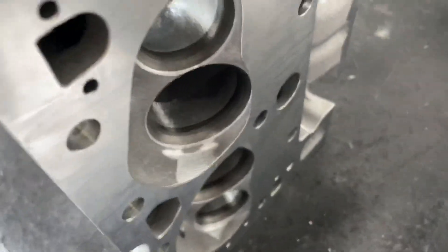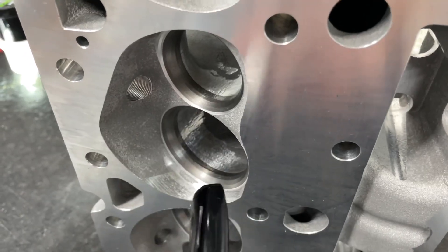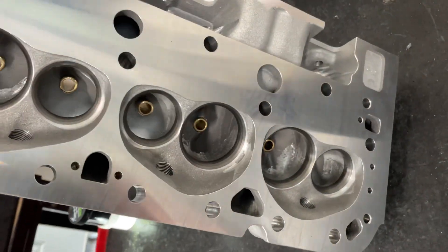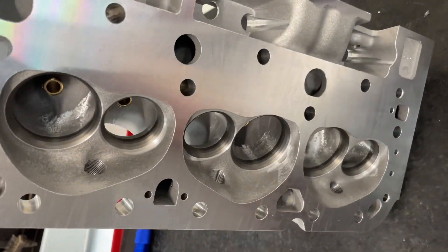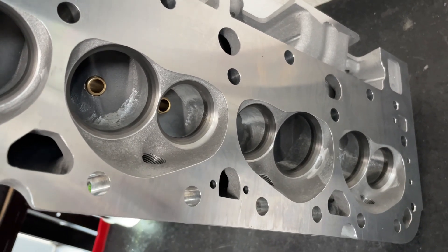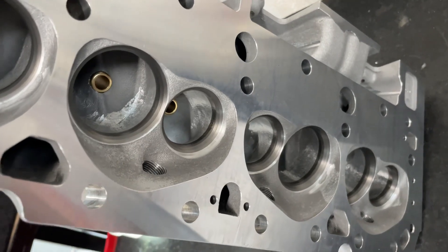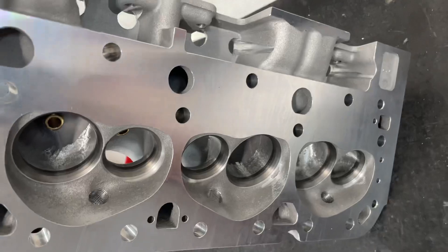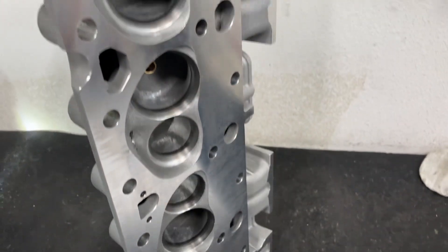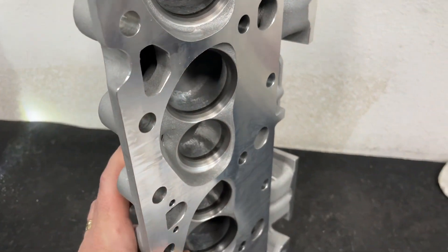That's the bowl blend - it's not cartridge rolls, it's just burr-and-gone, as you can see. I will say these heads - I've sold to a customer - Profiler has gotten better about the guide clearance I mentioned in other videos. I could actually push a valve through here now, so it feels like they've opened up the guide clearance. I haven't checked the valve job because I'm just going to go ahead and do it anyway - I can already tell these probably aren't going to seal. So I'm going to valve job these and put them together. I'm not porting these - it's just for a customer's tow truck.